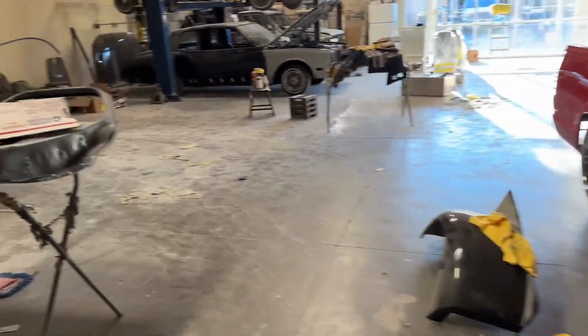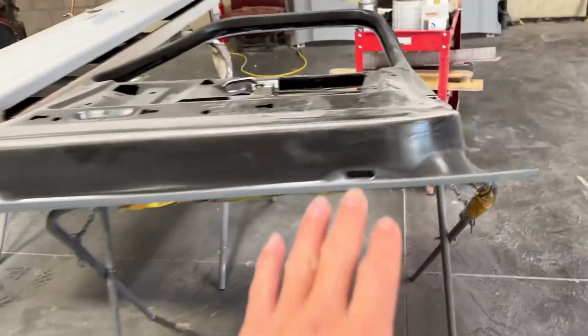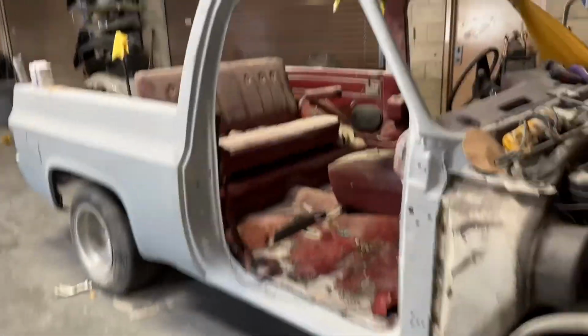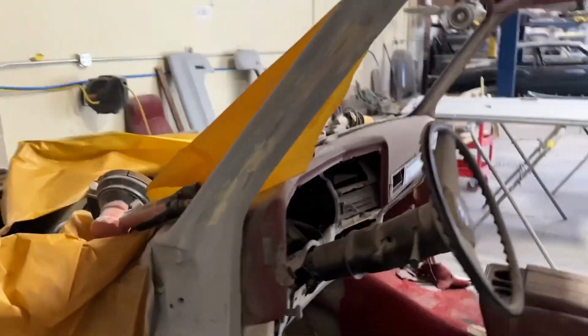But anyways, back to those parts I'm gonna be jamming. Pepe already got all the door jams sanded. Underneath the tailgate, that's sanded. And then these fenders, they're all sanded, ready to go. I'm gonna be putting a sealer on them, base coat, clear coat. And then hopefully I can squeeze this one in at the end of the day, jam the post here. That way the following day, well, probably next week, it's already Thursday today, they can go ahead, hang all that up, and then I can get the whole car over to my department so I can start getting it ready for paint.